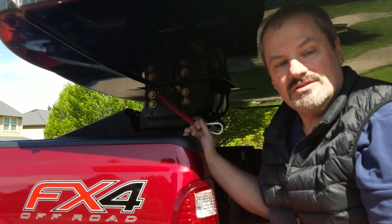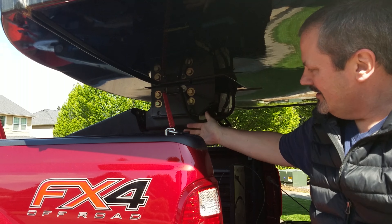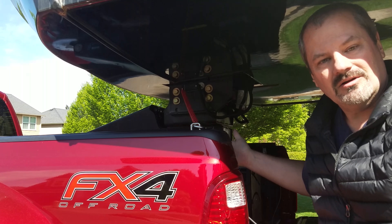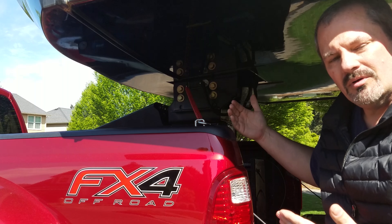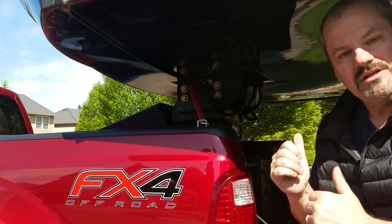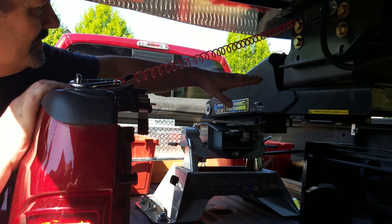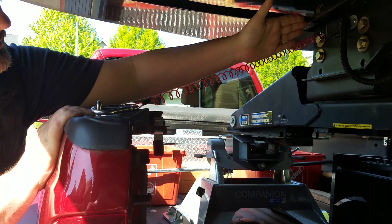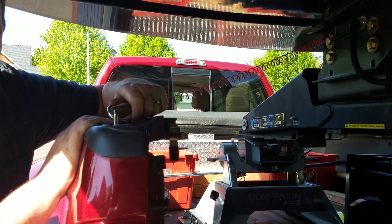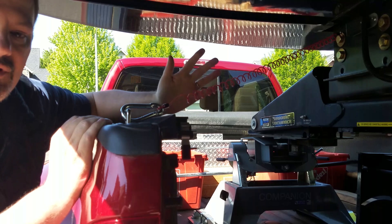I'm going to show you how it actually works. Let's assume I've just hooked up my trailer. Now I'm going to attach my brake — open my bullring, it's now ready. I take my breakaway switch, connect it there, and you'll see now that it's tight. Now it's not hanging down into the bed of my truck. I can put stuff here without worrying about that breakaway switch being pulled while I'm in route. When I do get fully attached, this is going to be basically parallel to my bullring, and it has plenty of slack to move around in the wind but it's not down into the bed. All I have to do is a quick connect and I'm done — I don't have to climb up into the back of my truck every time. Really a nice way to upgrade your breakaway switch.